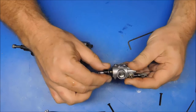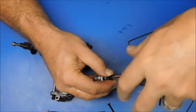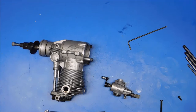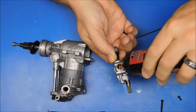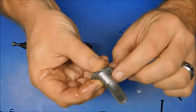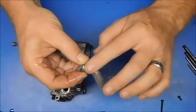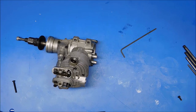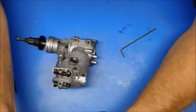Got a nice o-ring here. With as little use as this has gotten, it's really puzzling as to why that throttle barrel doesn't rotate, but it's easily remedied — I can just drop some oil in there and maybe apply a little bit of heat to it. This intake manifold has got some pretty heavy discoloration; I don't know if I'm going to be able to buff that out, but we're going to try. I should have gotten a parts bin ready — I'm going to start putting these parts in a bin.